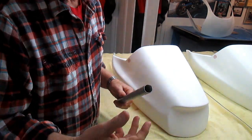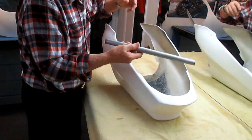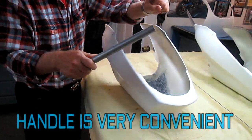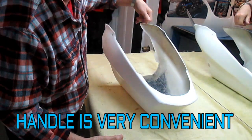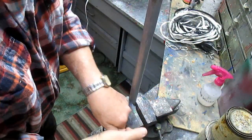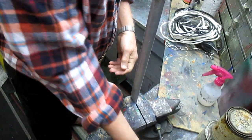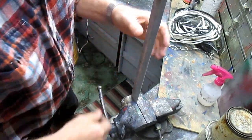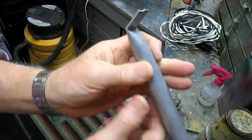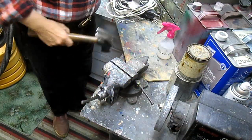This looks like a piece of an old aluminum lawn chair. Aluminum tubing is always something I can use — I never throw a lawn chair away without cutting some of it up. I need to put some bends in here just like I did yesterday. It was exactly the right size — what that's going to allow me to do is hold it in position, hang it. Trying to hook it in around the bolt holes ruins the paint around them. It just makes the job a lot easier when you have a handle on it. Squeezing the tubing down makes putting bolt holes through there a lot easier — very similar to what we did when we did the fairing. I'll drill a hole, get these angles correct, and put in some nice new bolts from Bolt Depot. I pretty much have the angle right now.